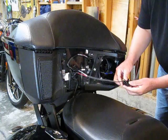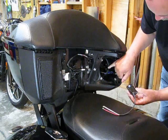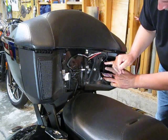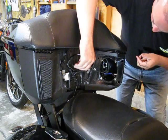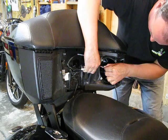I put some heat shrink around the cables just to protect them, plus I like it all covered in black. I made a groove in the edge of the plastic casing here, because what I'm going to do is put some hot glue around the edges, and I'm going to place this inside with the selector switch going through one of the holes so I can gain access to it from inside the trunk. The wiring will go behind here. There's a little piece of foam in there — I'll have to get through the foam, and it will come out here, and I can tap them into the cable. The speaker will just fit inside, and it will also hold this module in place. I'm going to use the back end of my scribe to push through the foam in order to make a hole for the wire.